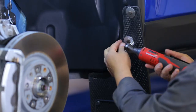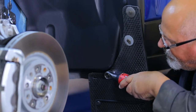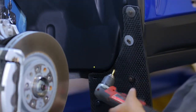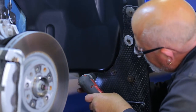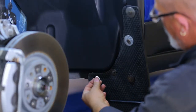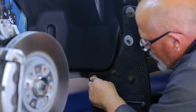Once leveled, tighten all bolts currently installed and check that the flap is still level. Next, use a quarter inch bit to drill through the final mud flap slot and into the liner. Then place a number 10 screw and number 10 washer into the newly drilled slot, secured in place using a washer, lock washer, and nut.